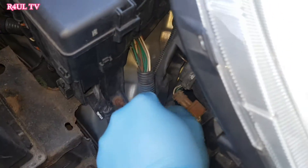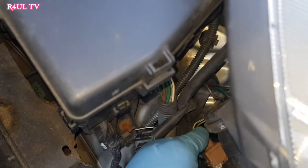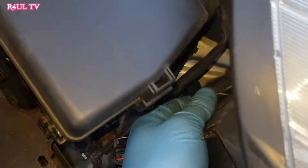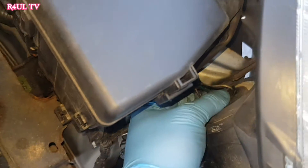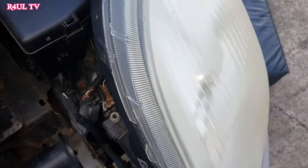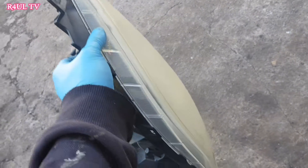Obviously I'll need two hands — one to move the bumper away and the other just to get the headlight out. The wiring plug — you could take it off from here, dead easy, just push-on clip on the wiring plug. Another one there goes from underneath. Or what you could do is take the bolt out that way — no messing. You can just fit it on the other one, same with the headlight bolt. There we go, that one's out. The whole headlight is now freestyling, so I'm going to take the headlight out from there. And there we have it guys — the full headlight off.